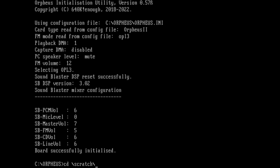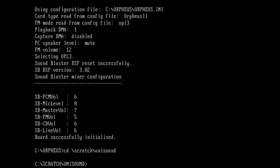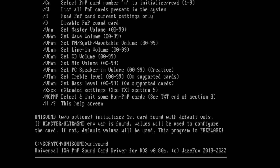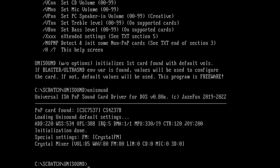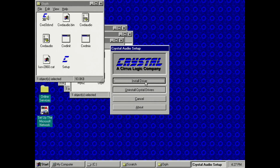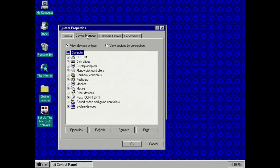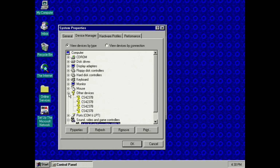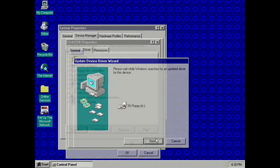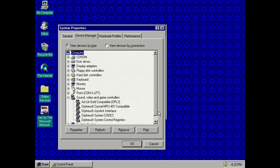If you're a big fan of the Unisound driver, I'm happy to say that the Orpheus cards are supported there too. You may not be able to set everything like you can with Orphinit, but all of the various settings available should work, and I'll put a link to where you can find out more about Unisound in the description below. Drivers for Windows 95 and 98 are also available for the Orpheus II LT. A Crystal driver package appears to have been customized for this purpose. In the typical Windows 95 style, I had to install the drivers for several different detected components, including the Crystal codec, Crystal MPU-401, the joystick interface, and system control registers. But yeah, everything went really smoothly and I didn't run into any problems at all.